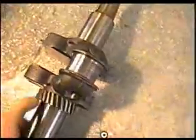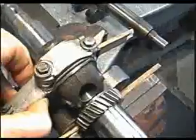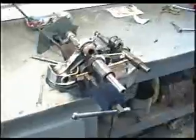Here's another crankshaft. Sometimes when you blow a connecting rod, there's going to be residue of aluminum from the rod on the shaft. Sometimes you have to file or sand it down. What I think happened is they filed it down way too much. The thing is so loose now — if I ran it a little while longer like that, the rod would have broke and possibly broke the block as well.